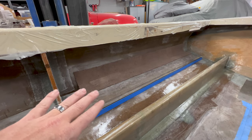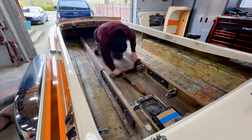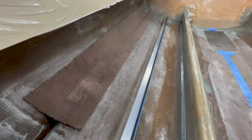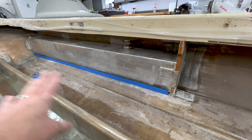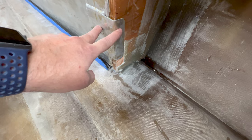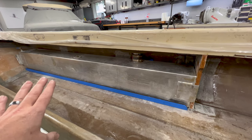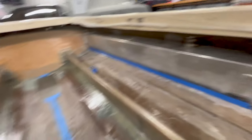I've got some old carpet laid where the fuel tank sits as mock-up carpet — I don't want the fuel tank sitting directly on the fiberglass bottom. I cut some old carpet from the boat and I'll use that to sit under the tank so I'm accounting for that carpet thickness in my mock-up position. On the angle, I've got the foam on and the bottom has been ground up to rough it so we can adhere it to the bottom of the boat.